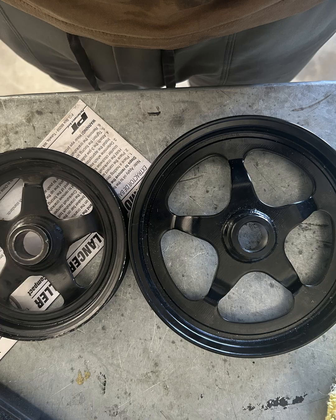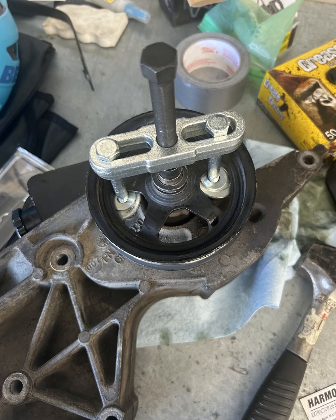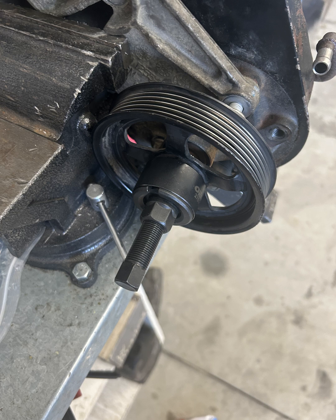So I can use that proper pulley size. This is me just modifying a steering wheel puller with some washers behind that pulley to pull it out far enough, so that I can actually get the real pulley on there and get that off. Here's me just taking off the pulley with that normal pulley puller.